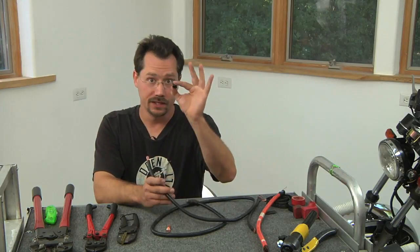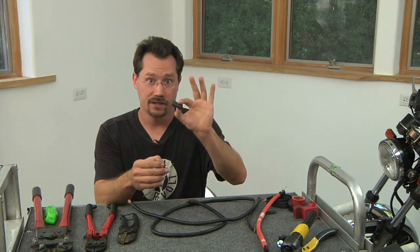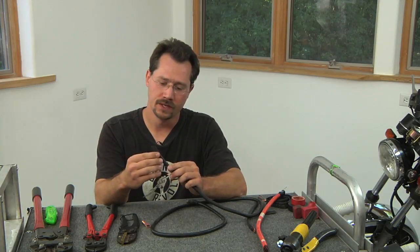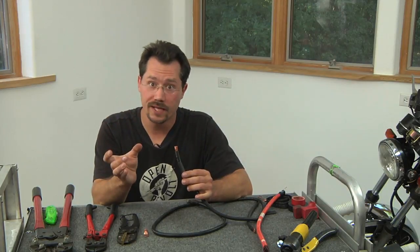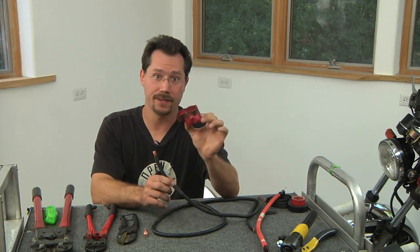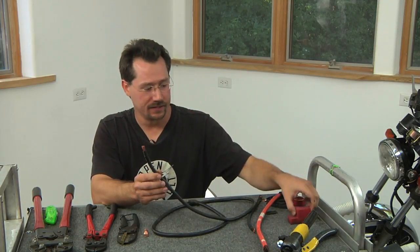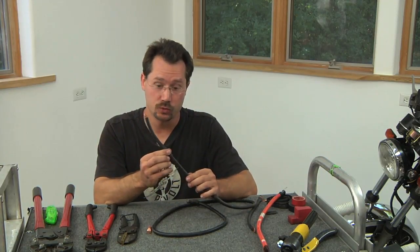Before you do anything to the end of your cable, you'll want to slip on a little heat shrink tubing — it doesn't have to be very long, just enough to cover that half of your terminal and stick over the end of the cable. If instead of a typical lug you're going to use a large automotive clamp-on connector, you'll also want to put on any boot that goes over it at this time, because for some of those larger clamping connectors it's impossible to get on once the connector is in place. With a plain lug it's less of an issue, but do put that shrink wrap on right away.